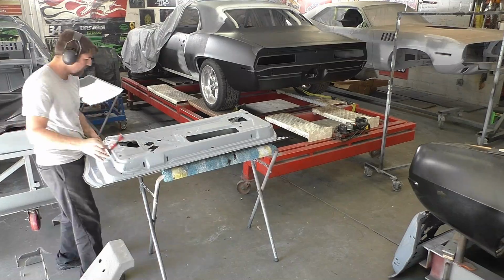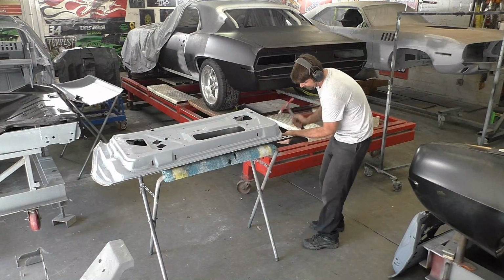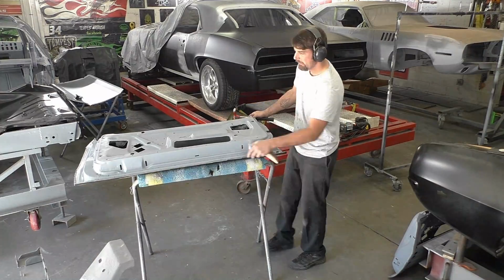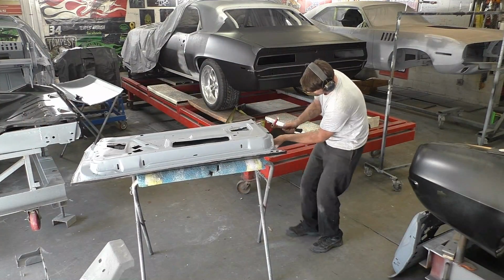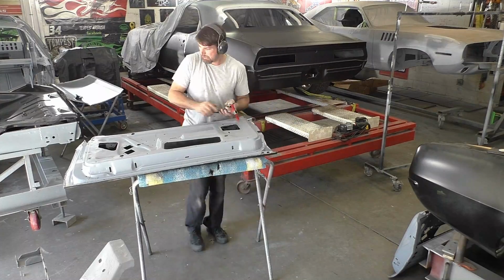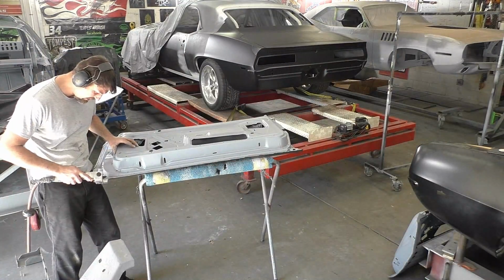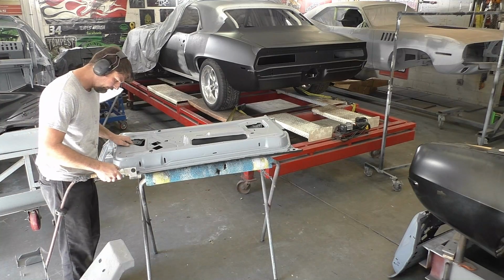But you see, once we got the door skin happily positioned where we want it on the door frame, I'm going to go ahead and take a hammer. It's a flat hammer, if you could see, so it's not stretching and rolling all the way around. It's actually a door skinning hammer, and I'm hitting it with a block underneath, not to bend the door skin.